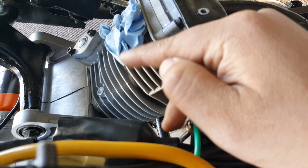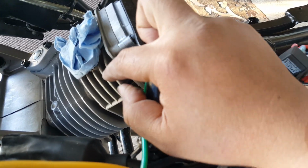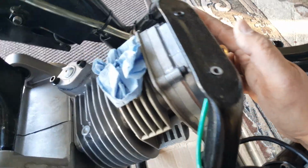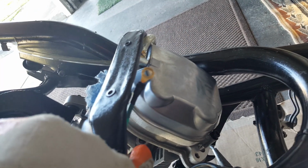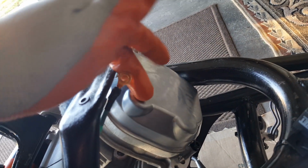And I realize now with the ventilation, actually, when the valve protrudes in, it opens the gap to the chamber. And then when it comes back, it sucks the air from the chamber back into the valves. That's why we hear a little hissing noise from the crankcase ventilation, which is connected. Those valves, when they're protruding into the piston, air is introduced from the chamber of the piston. Even though most of it is escaping out the spark plug hole because it's not plugged in anymore, it's still able to suck air in.